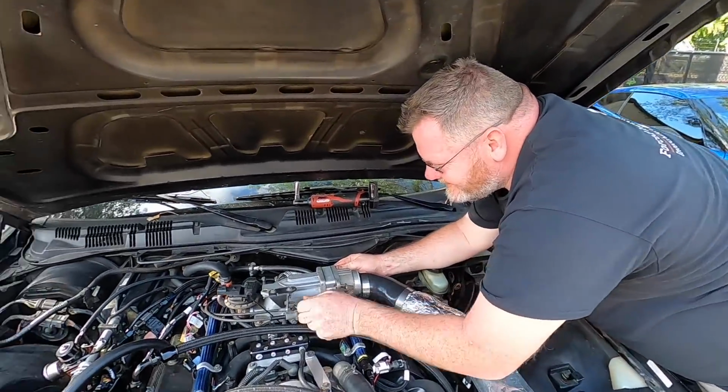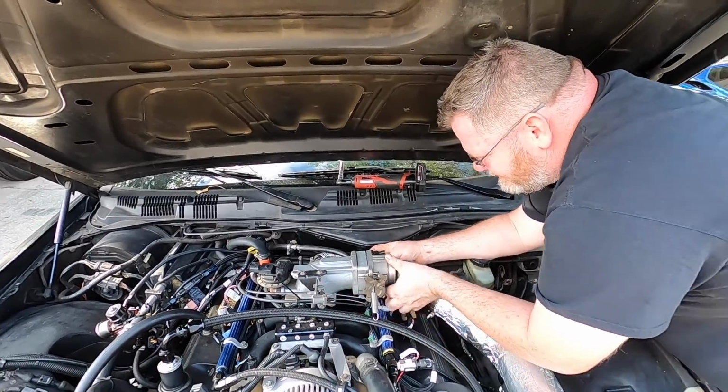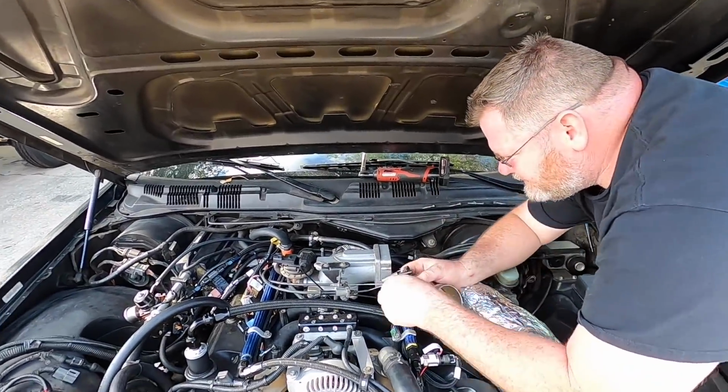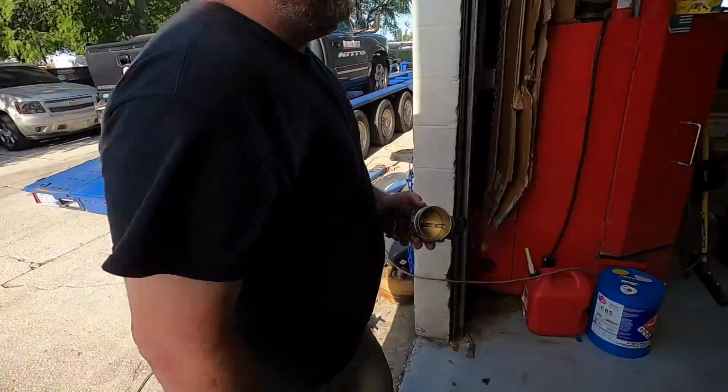So guys, what we're going to do is try and extend that lip right there on that throttle body. We're still going to use the same clamp, but the clamp can never really keep that in because, well, we just didn't have enough meat there. All right, so I think we just need to find ourselves some 3-inch and we'll be ready to rip. Hopefully a quick little one weld deal and be off to it.